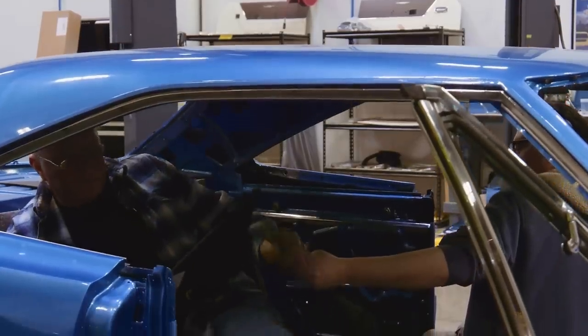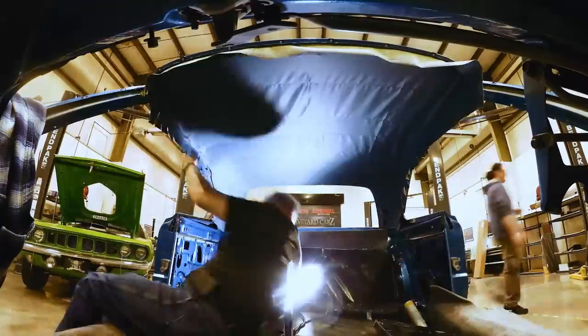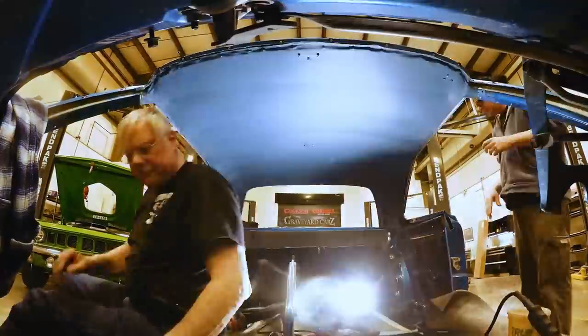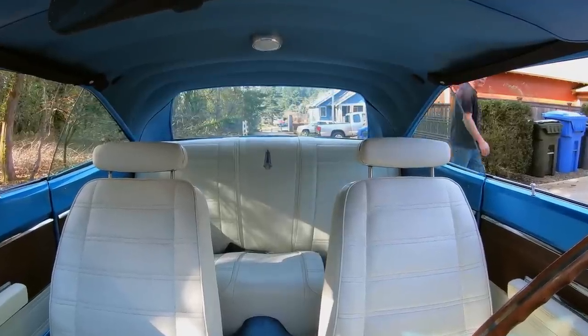These flashbacks always get me. I never took a lot of behind-the-scenes pictures, but when I get to go back and watch a few seasons ago, it's like a big photo album for me. Putting the headliner in the 69 GTX — it's my buddy Larry. It really always touches me. He did such a phenomenal job. He's a really good hardworking guy. If you've ever done a headliner, they are difficult — there's so much pulling and stretching to get them tight everywhere. You'll see cars at a show where the center area is tight as a drum because that's easy, but the reverse curves — where it goes down on the inside sail panels or up around where the visors mount — will have wrinkles. Larry's never did. They were always spot-on perfect.